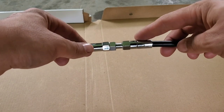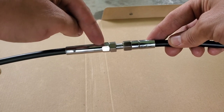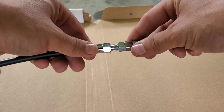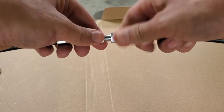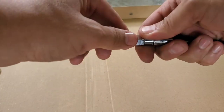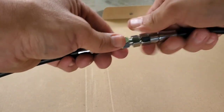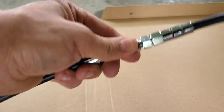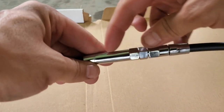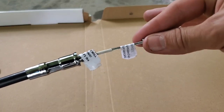Let's pretend this replacement cable is on the bike. You've got your jam nut tightened against the adjuster. You'd put a wrench on both pieces, break your jam nut loose, and then tighten the two parts of the cable together to collapse the threads. This would, in turn, give you slack in your cable.